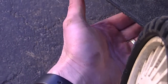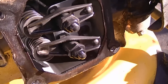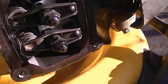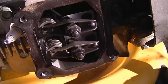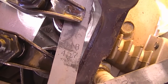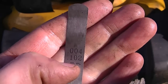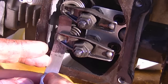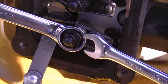I'm going to reach underneath and turn the blade again — again, make sure the spark plug boot is off. I'll turn the engine until the valve I just adjusted is fully open, then check the gap on the other valve. This one is really loose — way worse than the first one. It's at 18 thousandths of an inch, nearly four times the recommended lash, so it definitely needs to be adjusted. That was definitely contributing to the lawnmower being hard to start. I'm going to get the 4-thousandths blade and insert the gauge — it's going to be extremely loose.